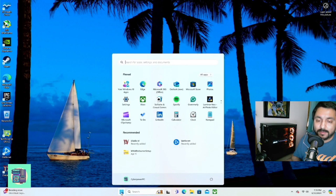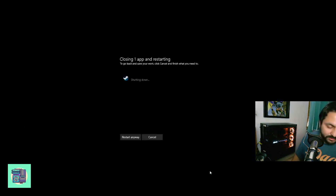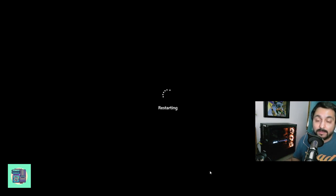To get started, go to your Start menu and restart your system. You access the BIOS by pressing F2 — you're better off just spamming F2 while you're waiting for the system to restart.